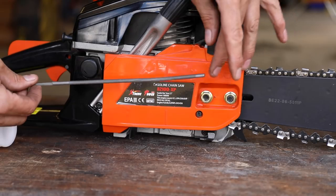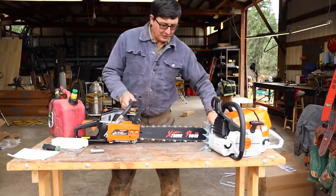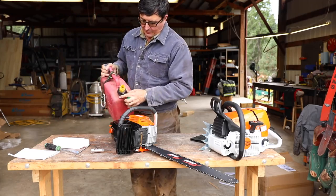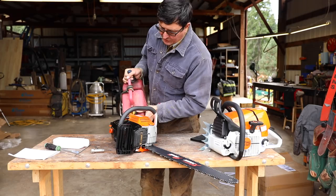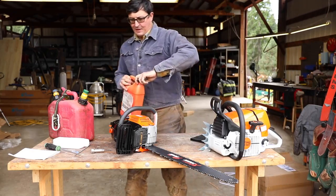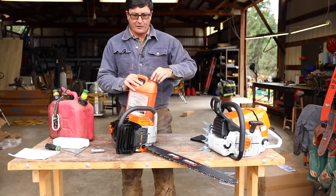Here's something I just noticed — see any problem with the file? It's got a little crooked bend to it. Let's fuel it up. I'm not going to mix a whole new gallon of 35-to-one. I'll put 50-to-one in here and then give a little extra dollop of oil to make it a bit richer. If you go a little bit either way it's probably not really the end of the world. So we've got some two-stroke oil here — just run it a little bit rich.